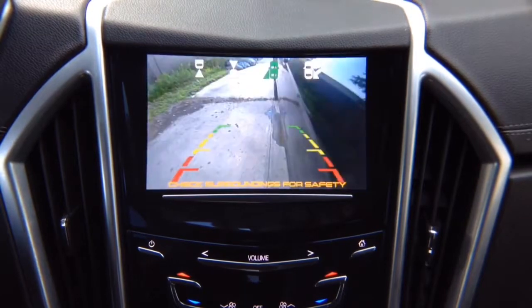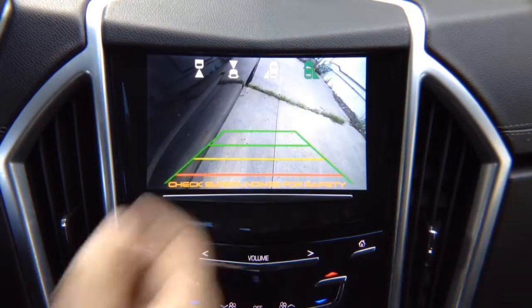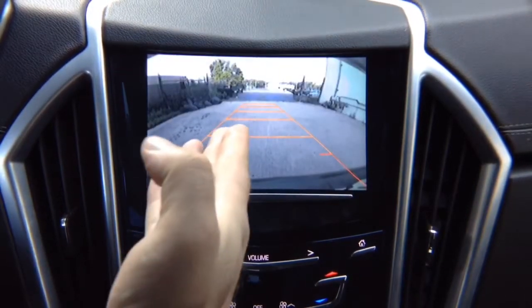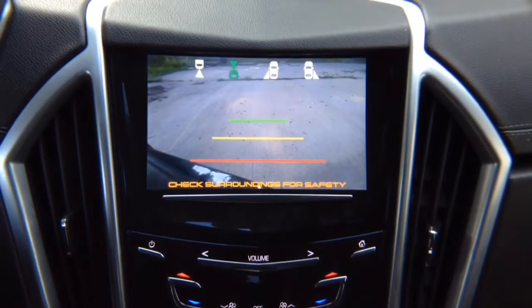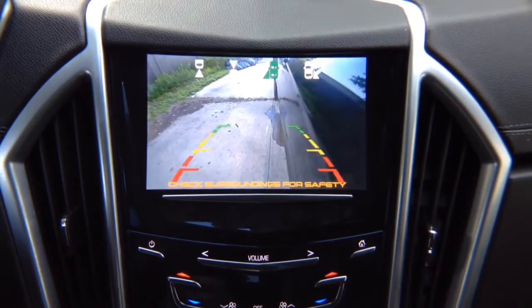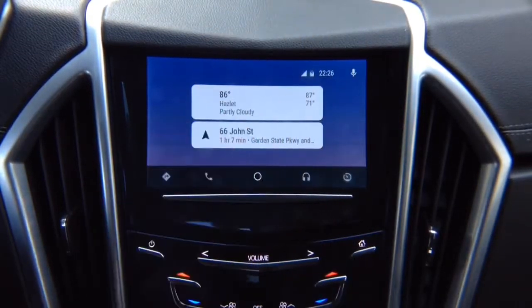Now, let's say you're in the interface mode and you're doing Apple CarPlay or Android Auto. Left turn signal, left camera, and it goes back automatically. Right turn signal, right camera, goes back automatically. In reverse, factory or aftermarket camera. In drive, front camera. Keep in mind, if you didn't add any of those cameras, it will not switch. So for example, if you're driving and you did not install a left camera, with the left turn signal on you will not have anything on the screen because it will just continue to show factory Android Auto or Apple CarPlay.